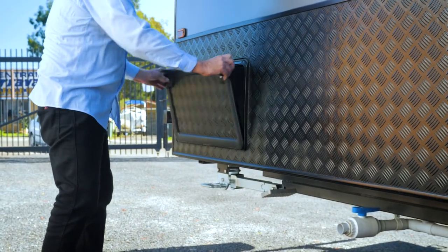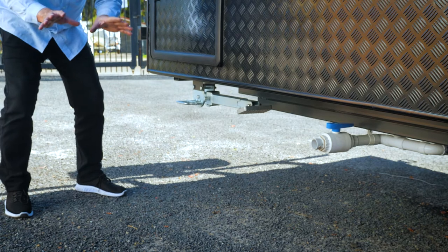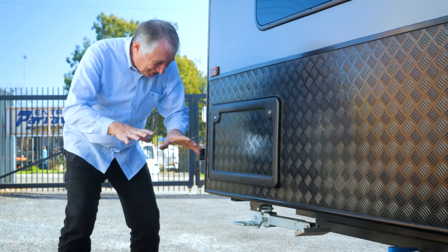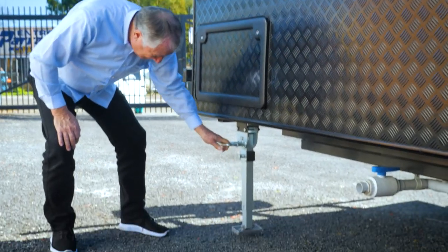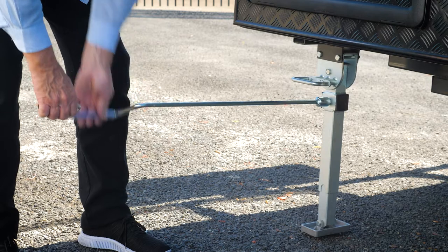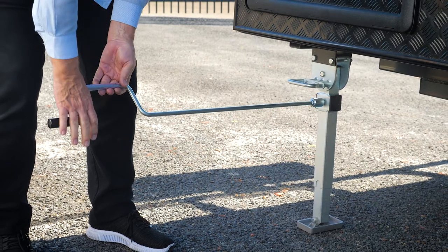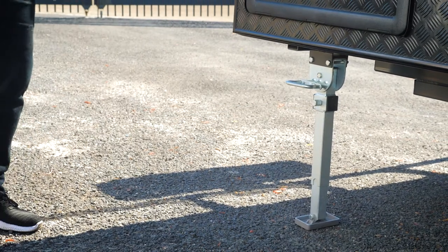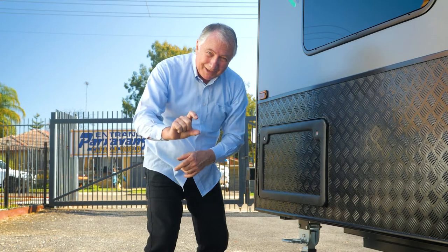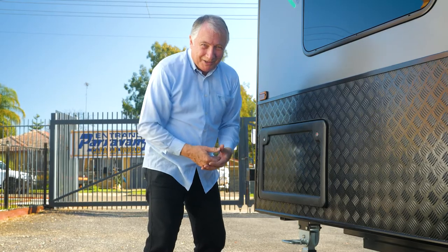Some of the vans will have an extra boot there. You've got your legs - each of the caravans will come with four legs, and they're not to be used as jacks. They're for stability, so when you're parked and unhitched, drop the legs down. Grab your jack handle that comes with your Paravans caravan and lower the leg down so it's on the ground - do that on all four corners. If you're on soggy ground or sand, carry some chunks of wood, put those underneath and lower down - that gives your footprint much better stability.